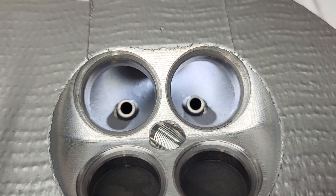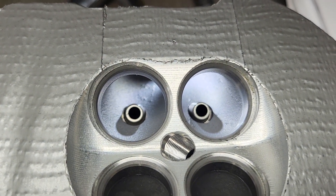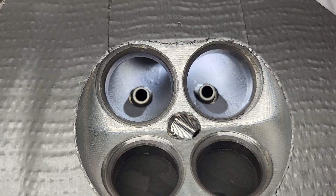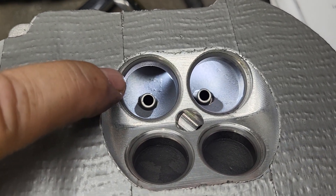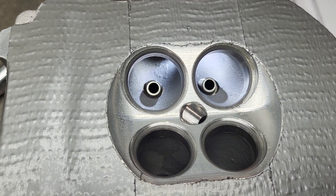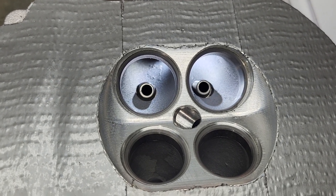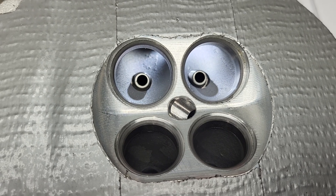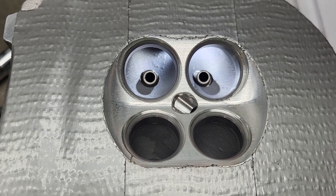The intakes are very straightforward. They're both dead straight, coming to a central point. No swirl induced at all. If you guys do some research on DV's polyquad design, he uses four different size valves to initiate swirl. He also does it with bigger valves on one side — so if he made this the bigger intake valve, it would also have a bigger intake port. I am going to try to initiate some swirl into this, but I'm not going to be able to measure it because my swirl meter needs to go through the bore adapter, and I can't do that if I'm using my 500 CFM plate as our bore. So I'm going to have to kind of do it and hope for the best. The owner of this head said he would give us a full report on how it works out in the long run, so that will be interesting.